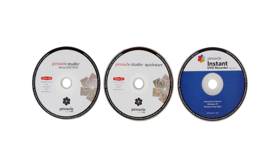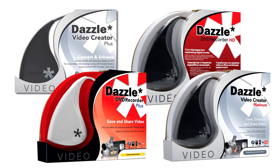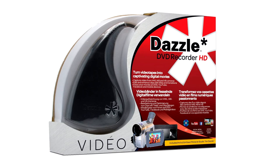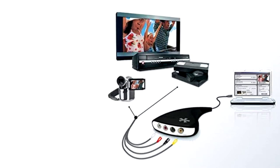You don't need Pinnacle's original software — it will only limit your endeavors. A quick note about suffixes like PLUS, PLATINUM, or HD: they identify different software packages, and sometimes they are linked to hardware or software features being locked or unlocked. In particular, HD doesn't mean that the device can capture analog HD video. For that, you need three-connector component video, not a single-connector composite. HD simply means that the bundled software can work with HD video files. All of these devices are strictly standard definition.